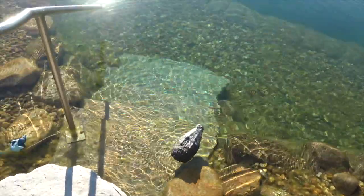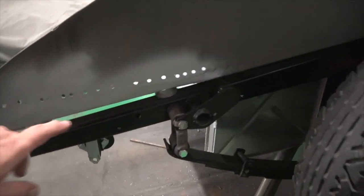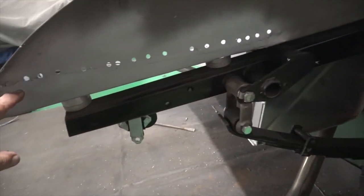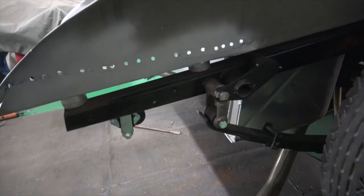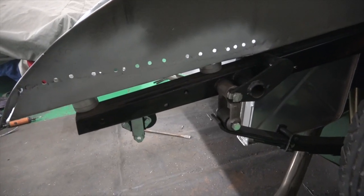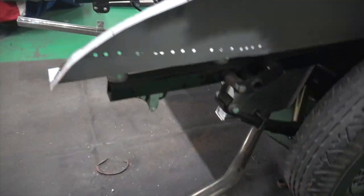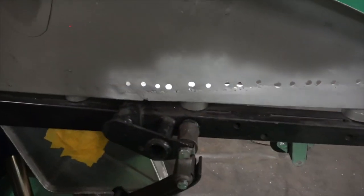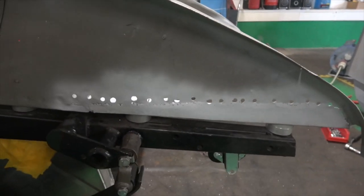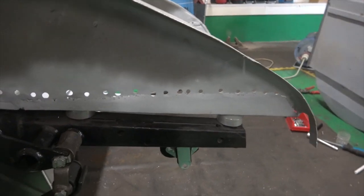Here's the order of the day. Two side pieces in there, they're bolted in position. Basically they were cut along here. You can see these holes here are the original holes we cut when we took off the original boot floor, or the drop sides. So all this is brand new all the way along there. You can see on the other side it's all brand new. These holes here are where we just took the spot welds out, but we've drilled them right through so we can weld it on the outside.